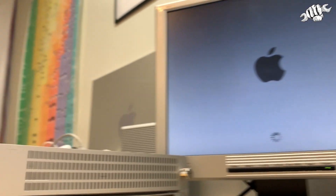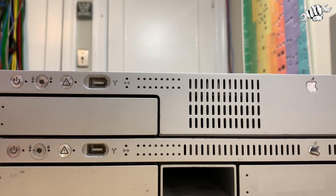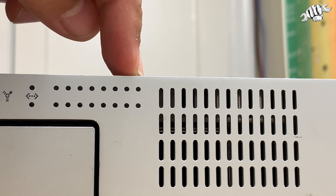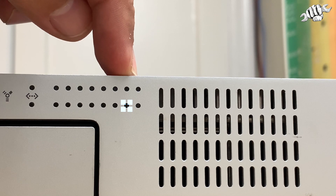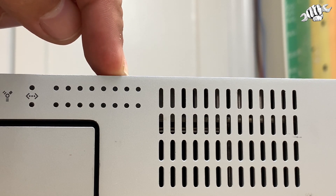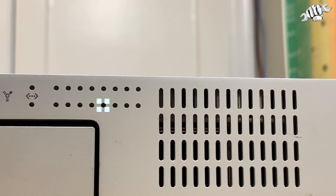So that's how you boot up your server using the front panel. Now for the Intel, it is different. Again, from right to left: number one is optical drive, number two is netboot server, number three is the first available system on a hard drive — so it doesn't matter what you set, it'll find whatever is available and pick it and boot from it. Number four is skip the current startup disk, just like with the G5, and boot from any system that it can find.